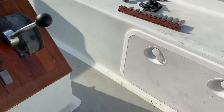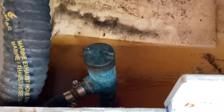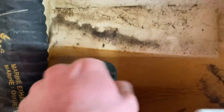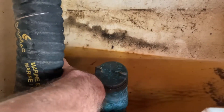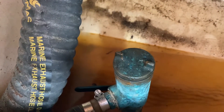To check this, you simply come round to your aft locker. Past the battery switch you should see the raw water strainer. The first thing to do is to turn the valve off, which is located behind it. It needs to be pushed at a right angle to the strainer, as can be seen here.